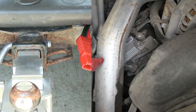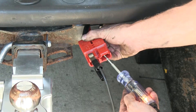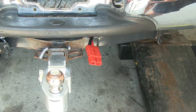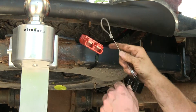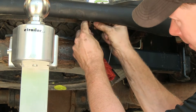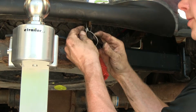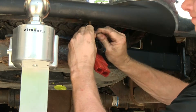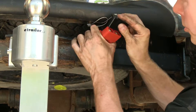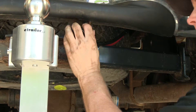Let's go ahead and check out our work. We're going to use a regular old light tester — ground our clamp to the negative side and check the positive side. Looks like it works just fine. Now we'll go ahead and put our cap into place. We'll run this through the little loop right here underneath the bumper, then run it back over itself. That'll hold our cap for us when the cable's being used. And we're good to go.